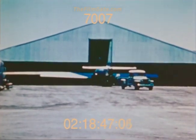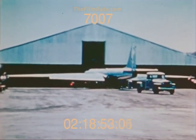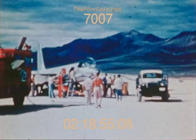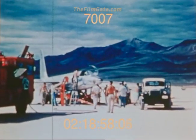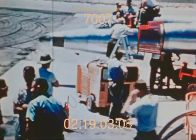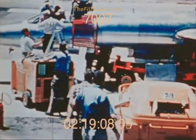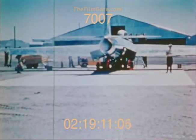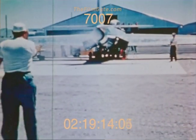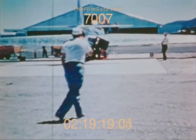This is the first rollout of the U-2. The airplane was quite a bit different than the originally conceived design, but retains some of the features of the F-104. It has a conventional tail and bicycle landing gear. Outrigger wheels, referred to as pogos, were added to the wings about mid-span to keep the wings level on the ground. Here is the original engine test run. Kelly Johnson walks up to check it out and see why it is smoking. First flight occurred in August 1955.